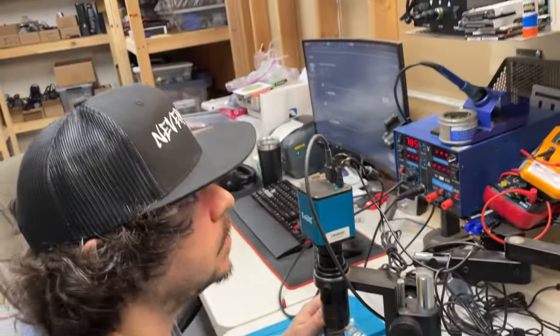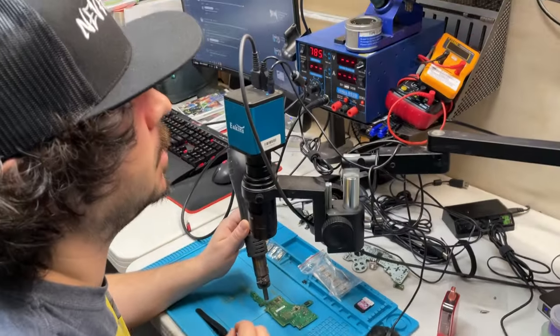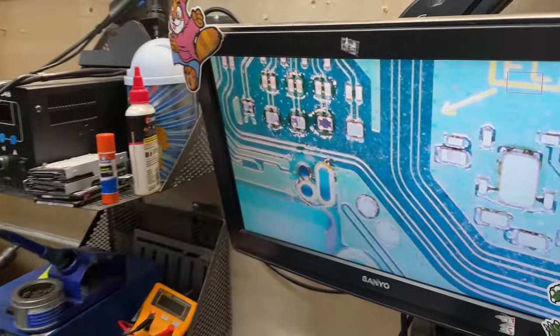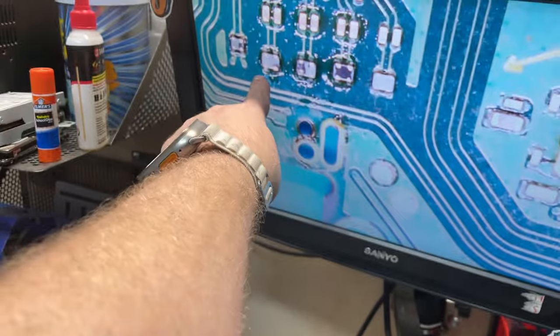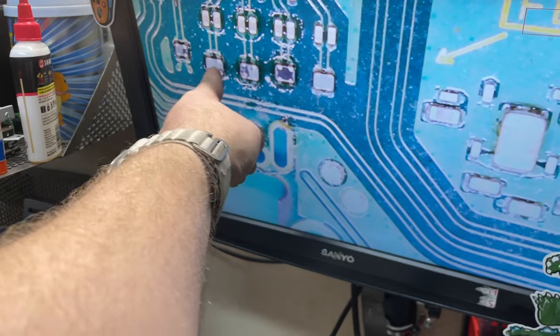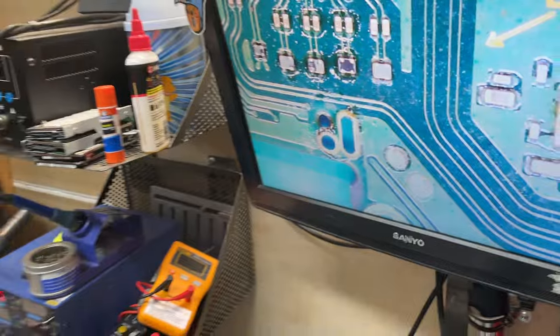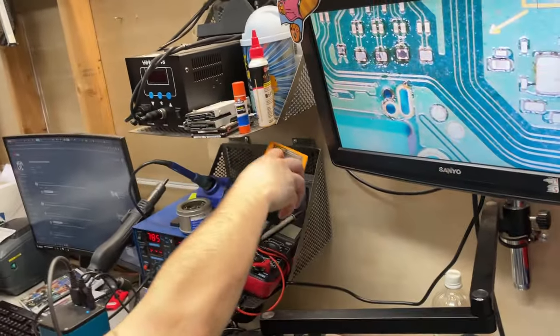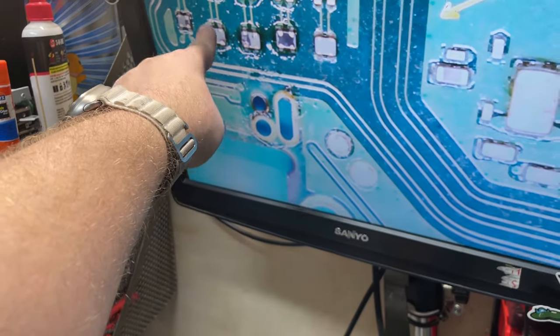We have it at 780 but the airflow turned almost all the way down. Nick's super afraid to go hot and hard. We're testing continuity - continuity tells us that you put it back on right, it's soldered on all the way and that it is working properly. Test it diagonally through the capacitors - if you have pass-through that means you soldered this correctly on the sides.